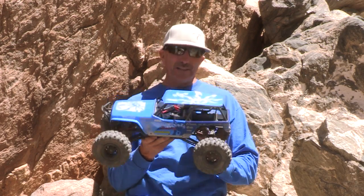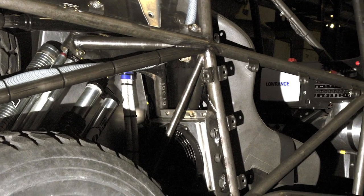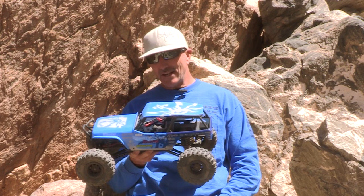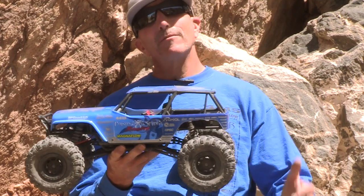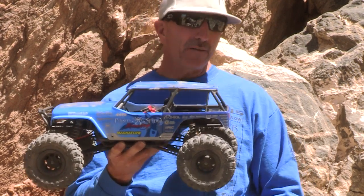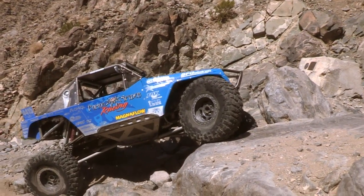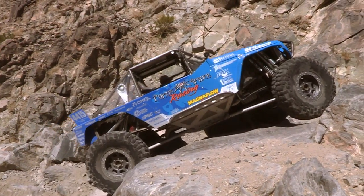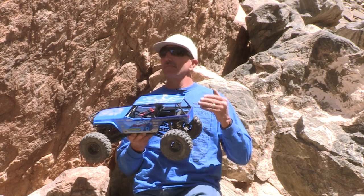Another logo you'll see on the Wraith and on my race car is Patton Steel. This chassis is all chromoly, which allowed us to use some thinner wall in spots where you'd normally need thick wall, and gives me the comfort of knowing I could wreck this thing at speed and hopefully survive. Having a good steel from a good company is a very important part of this chassis. One key difference between rock racing and rock crawling is that for crawling, the motor just needed to be reliable — gearing did everything else. When the sport evolved toward rock racing, motors became very important. I wanted reliability above all else, and we went to Turnkey — this motor's been in the car for maybe 2,000 to 3,000 race miles over a season and a half with no issues.